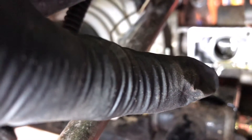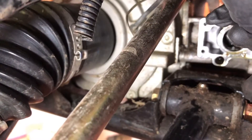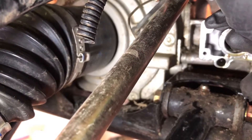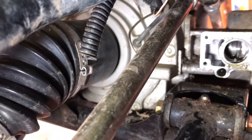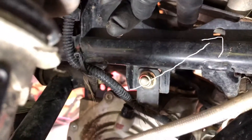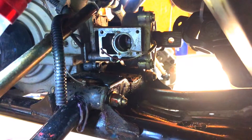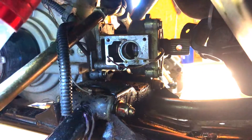Over here there's not enough room. The instructions that come with the kit say to take out the bolts that hold the differential end of the frame so you can adjust the differential up. But that does nothing because there's also a bracket right here that's bolted on, a bracket on the other side, and up here we have the power steering unit. So maybe I've gotta take these two bolts out — I'm only going to get a quarter inch, which is probably all I need, but I've got a conundrum going here.